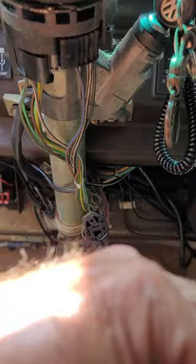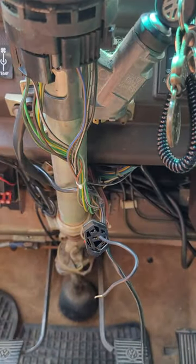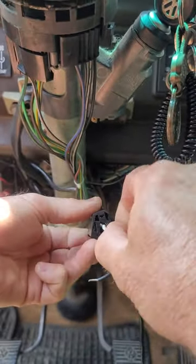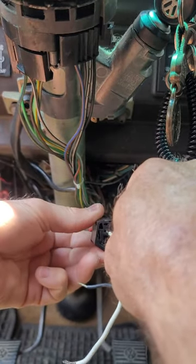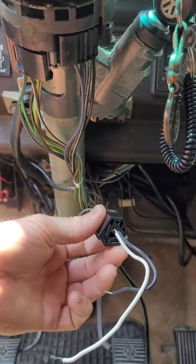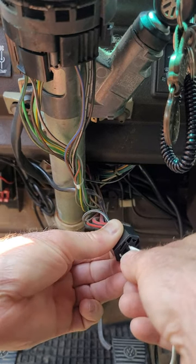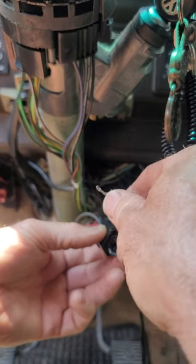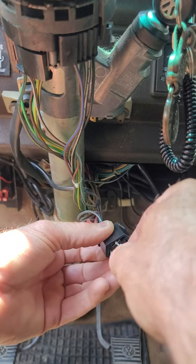You've got hot and two wires to hot. Your center wire — one of them is going to be lights, meaning the lights up above. That one is black, so black is lights. Then there's the ignition wire. And then your starter is going to be the big black-and-white and black-and-red.